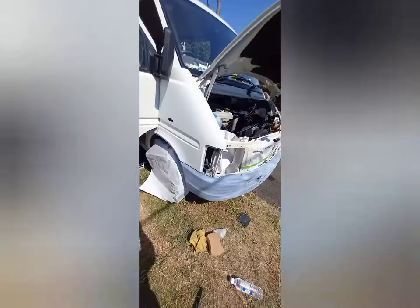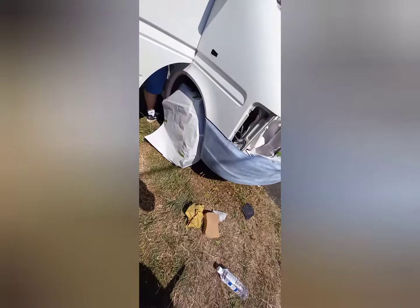We're going to give it another wipe down with sugar soap just to make sure we've got everything. There's a little bit of diesel drippage on the side so I have to clean that with some white spirit. Make sure you take all the lights out as well, and plastic prime the bumpers - otherwise the paint will stick, but you're better off plastic priming the bumpers to make sure the paint's got something to really grab to. I also sanded the bumpers and gave it another clean.